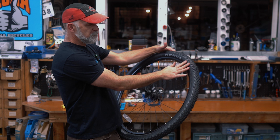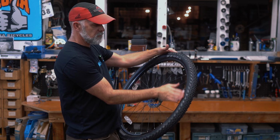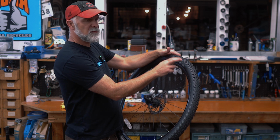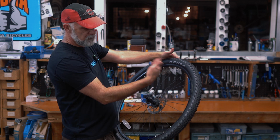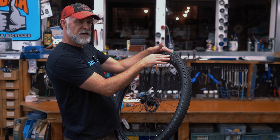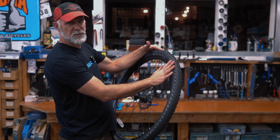One other thing to remember, whether it's a puncture that is maybe bigger or any kind of slice or blowout that you potentially put a tire patch on, you just need to get home at that point. So one good thing to do is not go up to that full pressure. In this case, if it's 45 PSI for optimal mountain biking pressure, if this tire is compromised, if you go up to 25 PSI, that'll be enough to get you home riding gingerly.